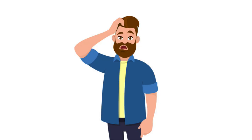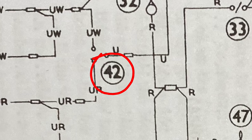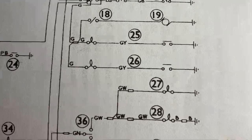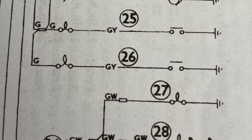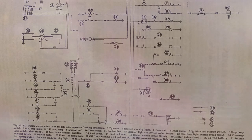Clear so far? Probably not. You'll also see the electrical components aren't labelled — instead they've got a number which you have to look up. To top it off, it's not even accurate. The wire to the oil pressure light is shown as green and yellow, when in fact it should be green and brown. So that's all clear as mud.